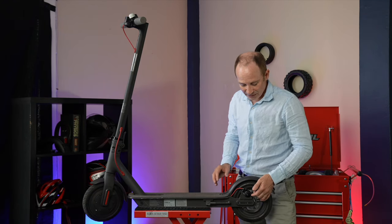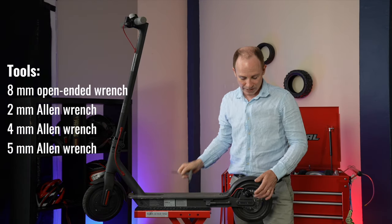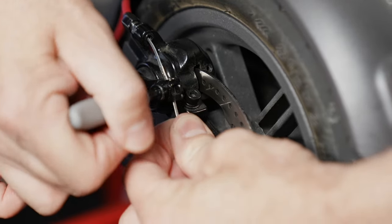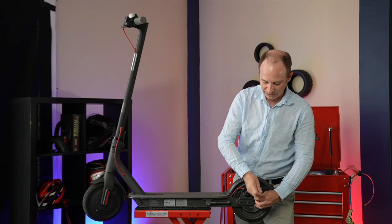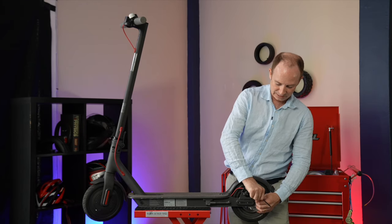To adjust that, check whether it needs a little bit or a lot. If it needs a lot, you want to go straight to the cable clamp. You're going to take an Allen wrench, loosen this, hold onto the cable, slide it forward about as far as you can, and lock it down again. Usually you'll end up with enough slack to where it's not dragging. In this case it's dragging a little bit, so I'm just going to back off just a little bit.